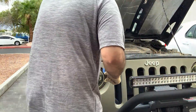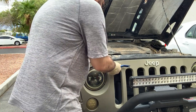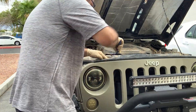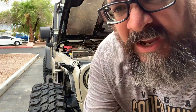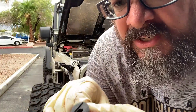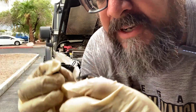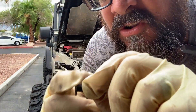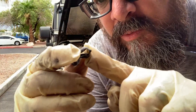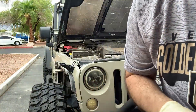So far so good. Some of these did separate, which is not a big deal — we can go ahead and just remove the rest of them to help remove the grill. We have the actual retainer itself and then the part of the tree that goes inside there. Even though the tool and the grill are both plastic, it's still safe because we're not damaging the paint. These are easily put back together — you just slide one back into the other. Don't push it in all the way or you'll separate the retainer.